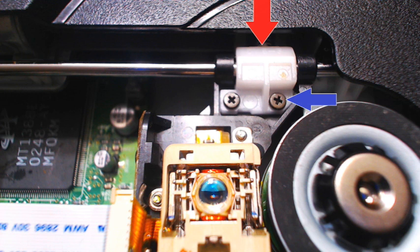This would be a major problem if the laser itself was a metal carriage. If it was a plastic carriage, it would be okay as long as the plastic hole was small enough for the screw to go in. I definitely did not want to get into having to tap the new carriage with a laser only a fraction of an inch away, and then worry about shavings getting in the way — all assuming I could find the tap small enough.